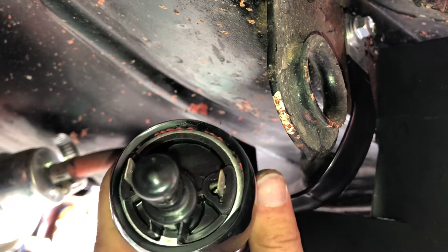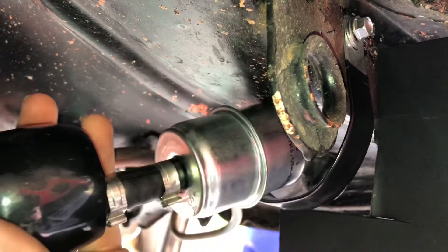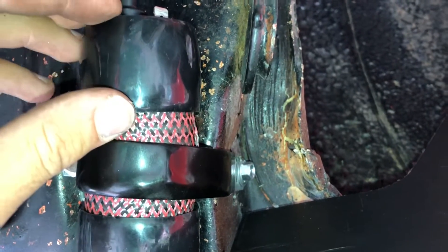Now I'm going to put the pump back in. Remember this side faces out. We can see the plus and minus sign on here — I want my plus sign on the inside so I can route it along the fuel line, and the negative to go up to the frame closely. Just be sure you know which one is which when you put your pump in — you don't want to wire it backwards and pump fuel into your tank. So it's mounted. You can see where I put the giant heat shrink here — this is like plumbing heat shrink — and then my Kevlar cover. Everything's isolated with rubber, no metal touching metal whatsoever.